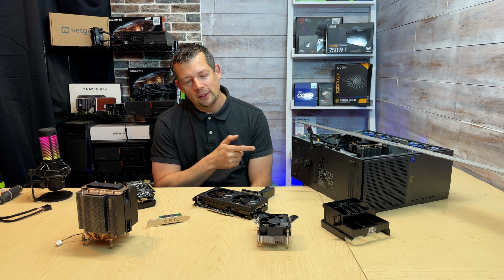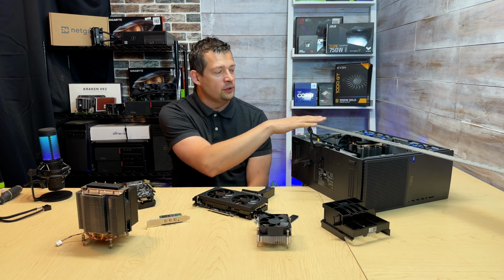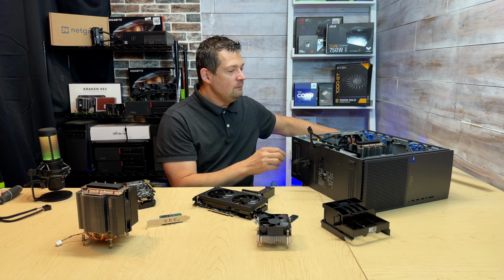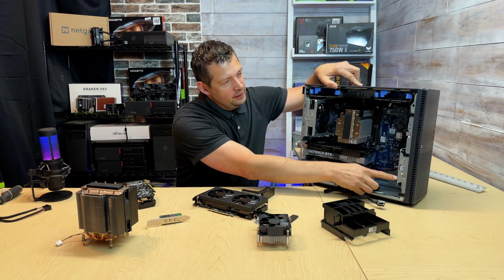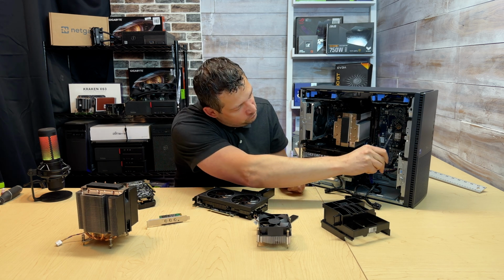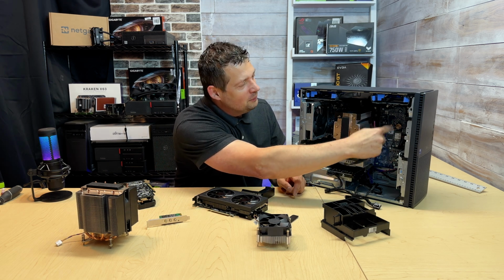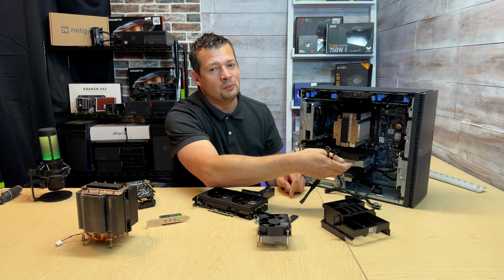Not only that, but if you don't want to do any of that stuff but still want to cool your video card or your CPU, do yourself a favor. Grab another Dell fan just like this one and just install it in here, and have a wire splitter. You only have one connector on the circuit board for a fan. There is another one marked and tagged, fan 3 LED, and it's all cut off from the circuit board.